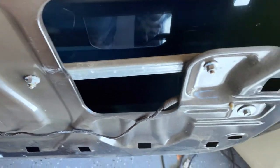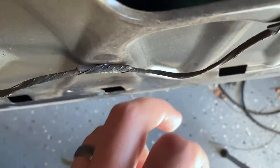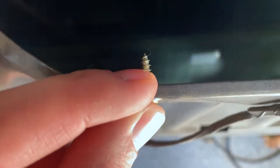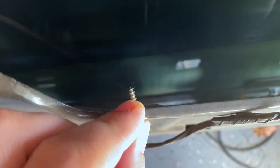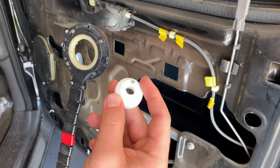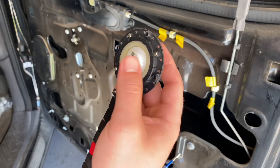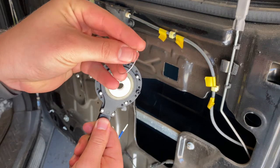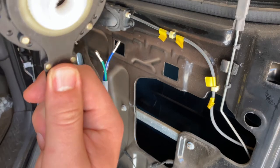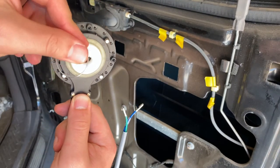With this door panel off, I'll take the opportunity to go ahead and grease inside of these tracks here, just to give it a little bit less resistance. And then also go ahead and check to see what kind of clearance I have between the inner skin and the glass — so you can see even if the screw was sticking all the way out, I'm nowhere near hitting the glass, so don't have any worries there. After you get these gears assembled, they'll need to go inside of the motor arm here. They'll only go in from the back side, so you'll push that through. And then you'll take these little keychain-looking rings — there's a small groove on the inside on the white part that this will snap into — so we just have to fit that around and get it on there.